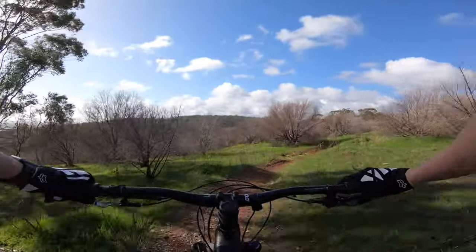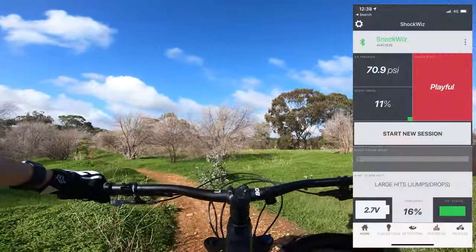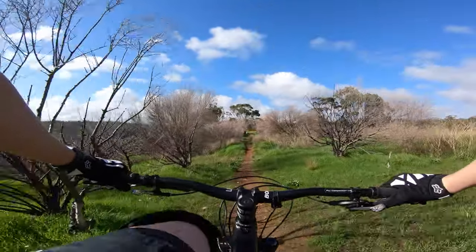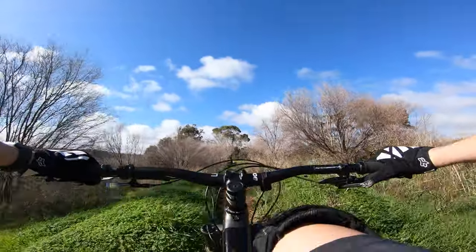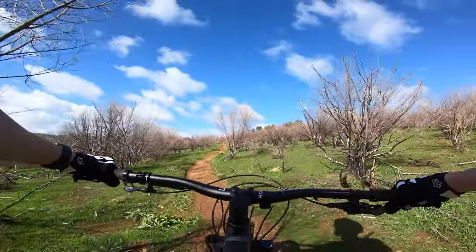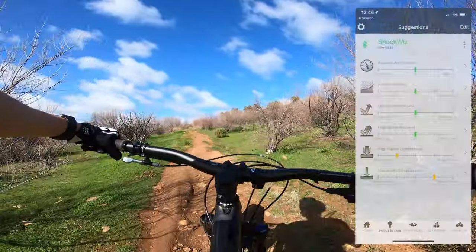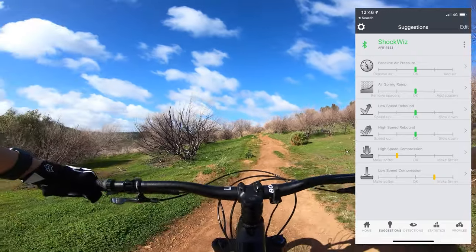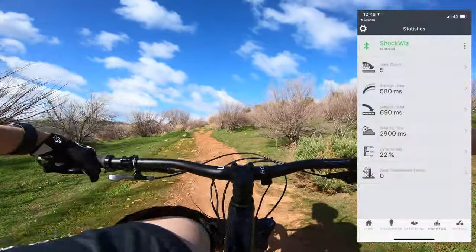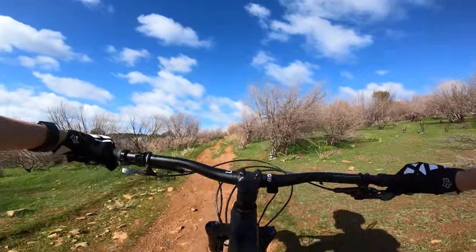Back at the top of Shepherd's Hill Recreation Park, going for run two. Confidence score is down after I reset my tune. It's wanting big hits and big drops — Downhill One won't really give you that, but Downhill Three will. Let's hit Downhill One first to get a bit more data for the ShockWiz and let it decide from there. After that run down Downhill One — 88% with good confidence. The ShockWiz is wanting more low speed compression. There are no deep compression events despite that rip-snorter nose dive you just saw. Let's see how it goes after another run down Downhill Three.